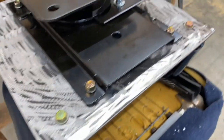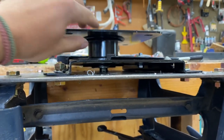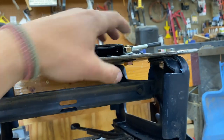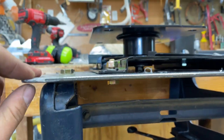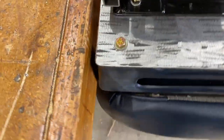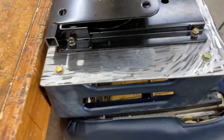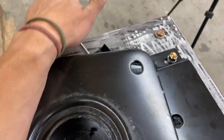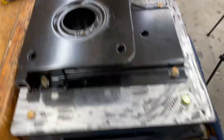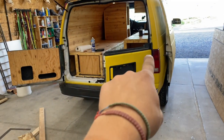Here's a closer look: these are the bolts that bolt into the seat, and then the swivel bolts are here. This plate metal is an adapter — three-sixteenths plate metal, which is plenty thick. You could go thicker, but I think it'd be a waste since it's no thicker than the existing metal. I did it on all four corners. Once I tighten these up, this swivel — you just pull that lever and it spins, then locks back into place. I'll bring it into the van and test fit it.